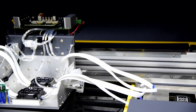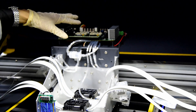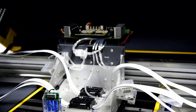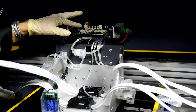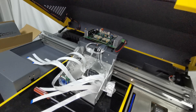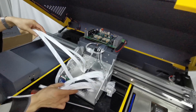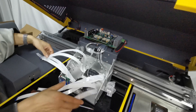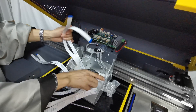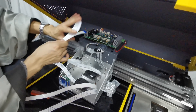Everything is taken out. From the carriage, we can see there are eight ports to connect the print head cable. When we enlarge the camera, we can see there are marks on the board. We go to the print head and the carriage board and start to install the print head. Each print head has four cable connectors — left two pieces and right two pieces — to connect the four print head cables to the print head ports.